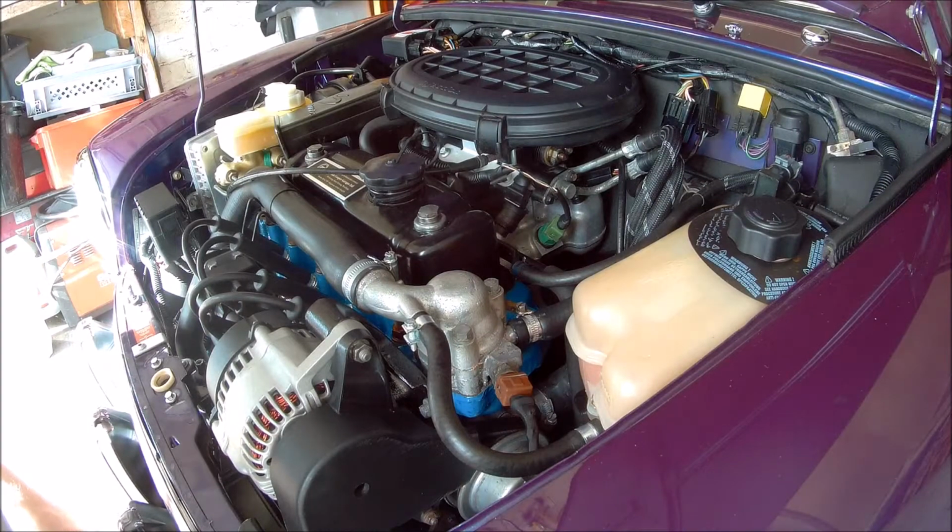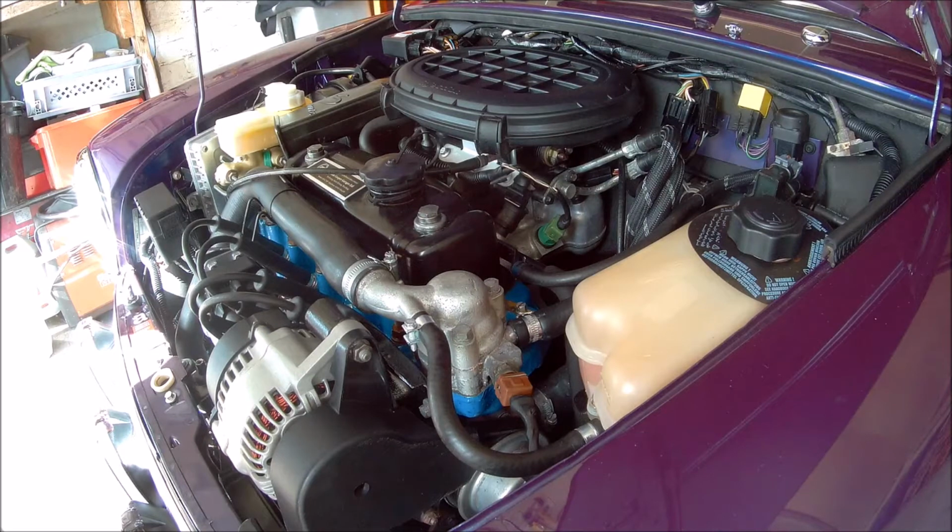Okay guys, so I'm a little bit loath to do this. I took PL for its MOT today. Driving really nicely actually, nice drive down there. Passed its MOT, couple of advisories on the slight play on the rear radius arm, so need to get that done. It was a very slight play, but I'll get it done at some point, probably over the winter. But yeah, I'm just not happy with this head gasket. I'm sure it's leaking. I might be wrong.